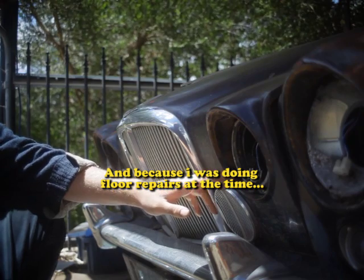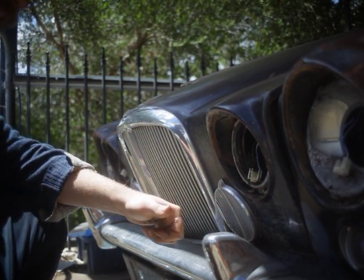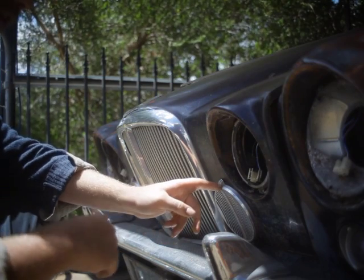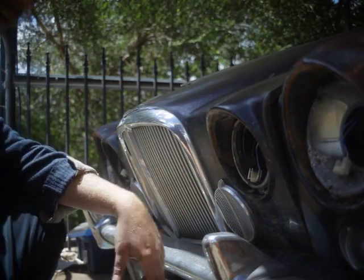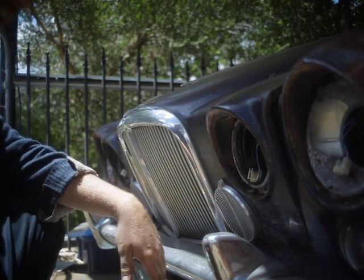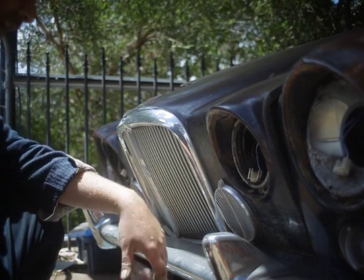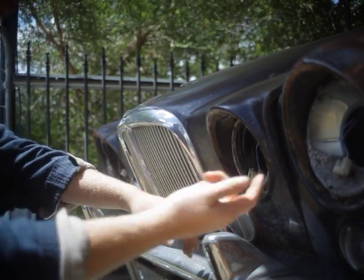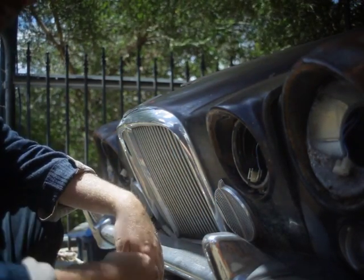That was to get it off, and I've had it off ever since. Now, working through my headlight issue, I realized that's actually a necessary component to everything working. It can't be just disconnected and left off. So I put it back in, and with some encouragement, it didn't work. But I used the junction wire just to bridge the gap, and my headlights are back.